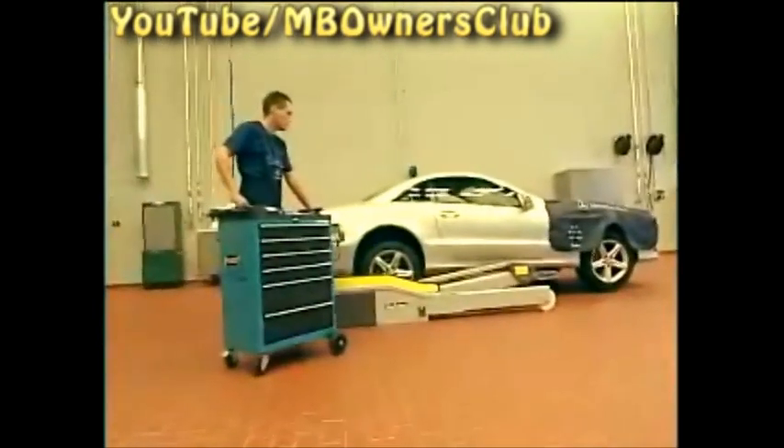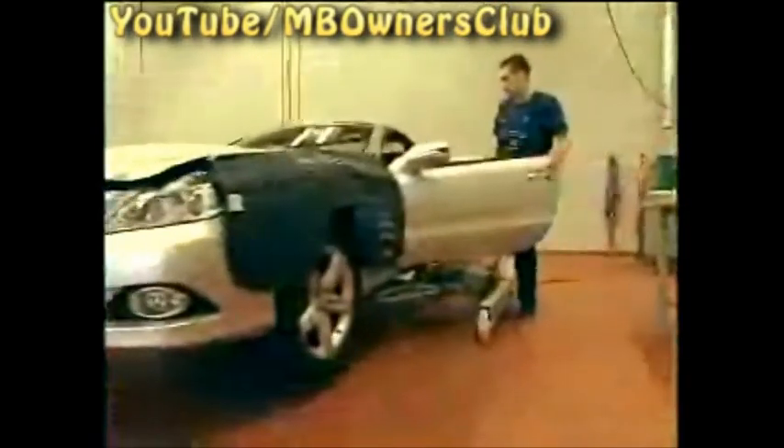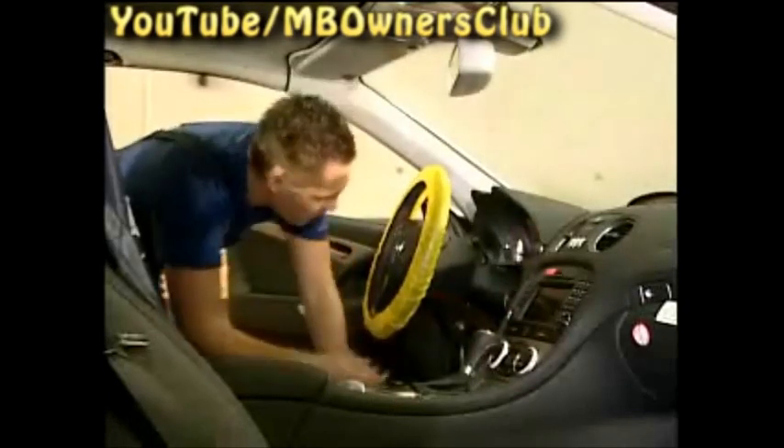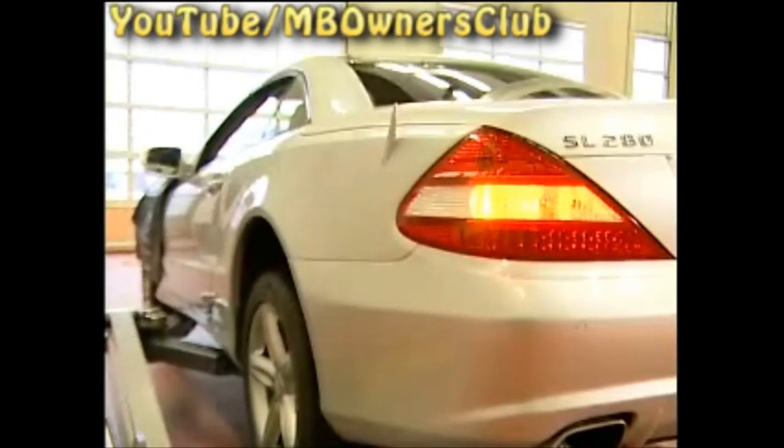Raise the vehicle on a lifting platform. The wheels may not touch the ground. Make sure all electrical consumers are off. Remove the key from the ignition, but before doing so, open the side window as you'll later need access to the ignition. Now close all doors and centrally lock the vehicle for at least 30 seconds. This allows time for the brake system to power down. Keyless go cards or keys must be kept outside the transmitter range.